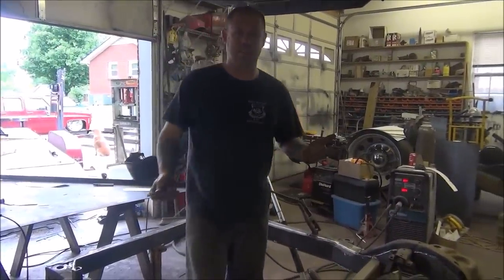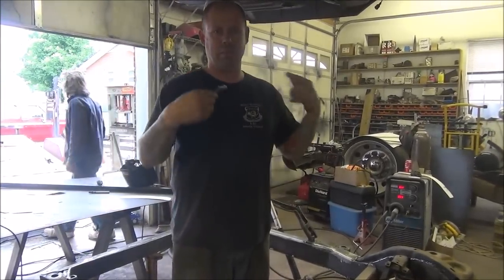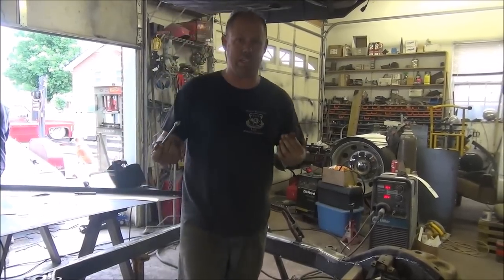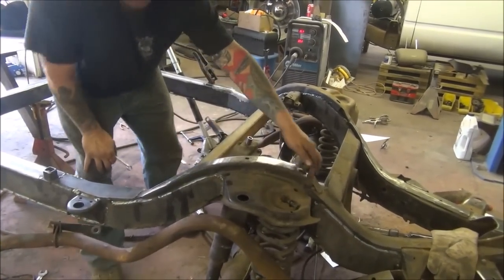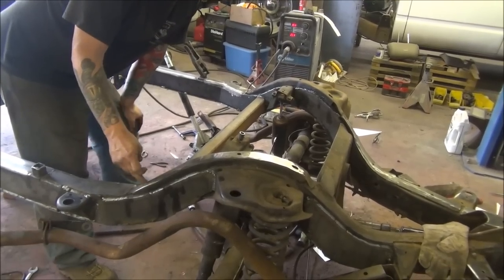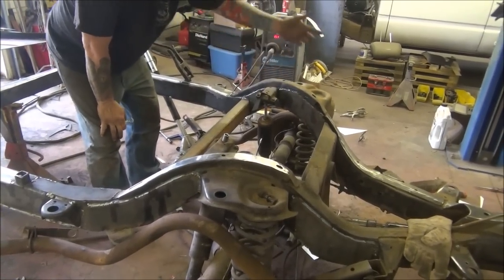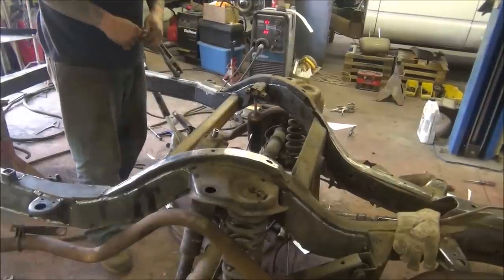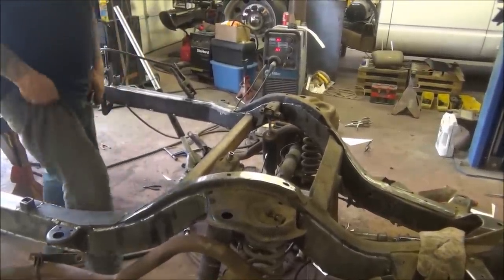Everybody knows that when you juice a car, there's a big difference between a hard top and a convertible. The hard top supports the car at a lot of stress points, and the convertible doesn't. One of the things Chevy did, taking this into consideration, is over the rear arches of the frame they added a reinforcement piece on both sides — only the convertible has this. It's got three holes in it and they mirror each other on each side. That added some reinforcement, but we're starting the process of adding more plate steel to the frame itself.